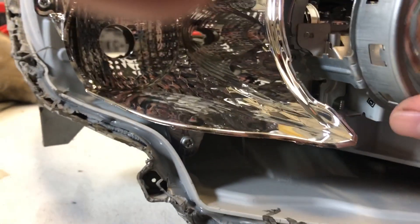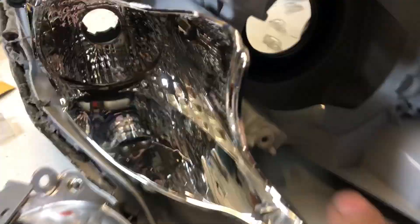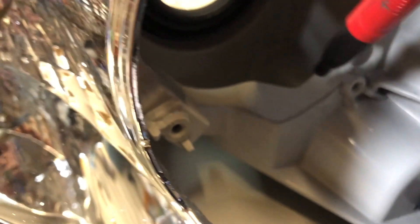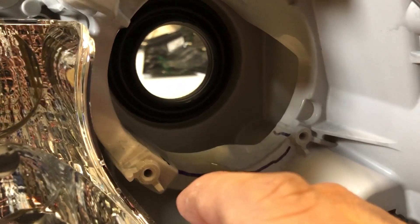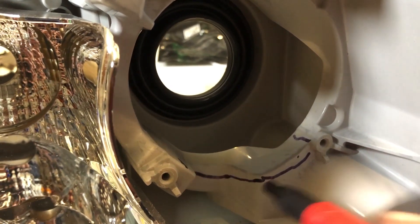This solenoid for the high beam right here — you will have to cut out this area almost all the way to about right here, and I believe all the way down to here as well. You also have to trim some off the bottom. I went down about an eighth of an inch right here — I'll start with about an eighth and I believe that worked.